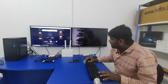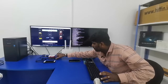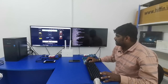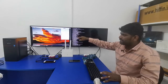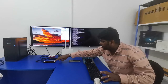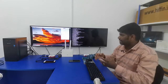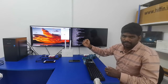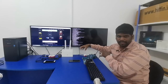On the second monitor you can see a different WAN IP address — that means my bonding router is connected. I have one phone and a second phone both going into my bonding router, and I am taking the LAN cable to my system so it shares internet to my system. This is the interface of the bonding router. You can see USB 0 and USB 1 — one phone connected to each USB port — and both are merging together to get a combined internet connection for good upload speed.